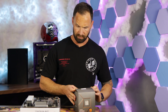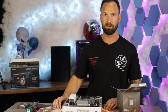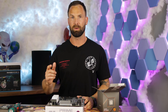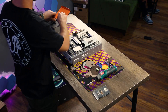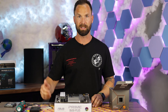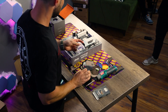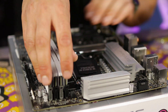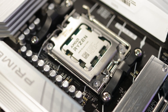We went with the 7900, not the 7900X, because we've only got a 240mm radiator — for the 7900X I think we'd be exceeding it, it gets so much hotter. The new chips that have come out are way more power efficient, which means way cooler. Intel was better for the close-up pop, wasn't it? Yep.